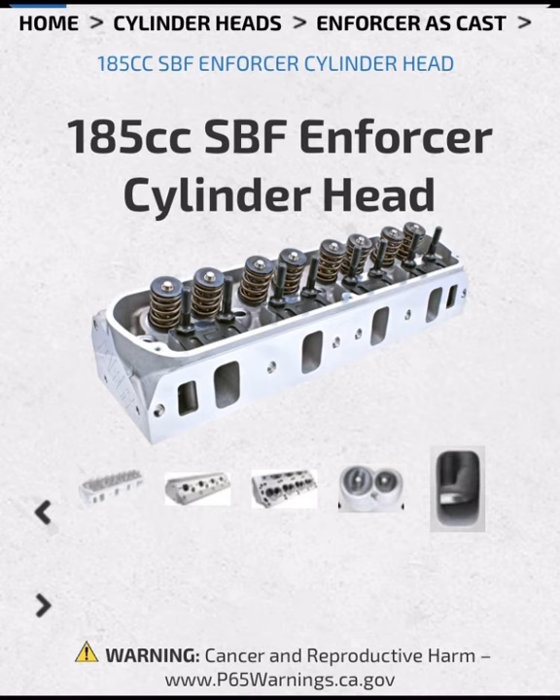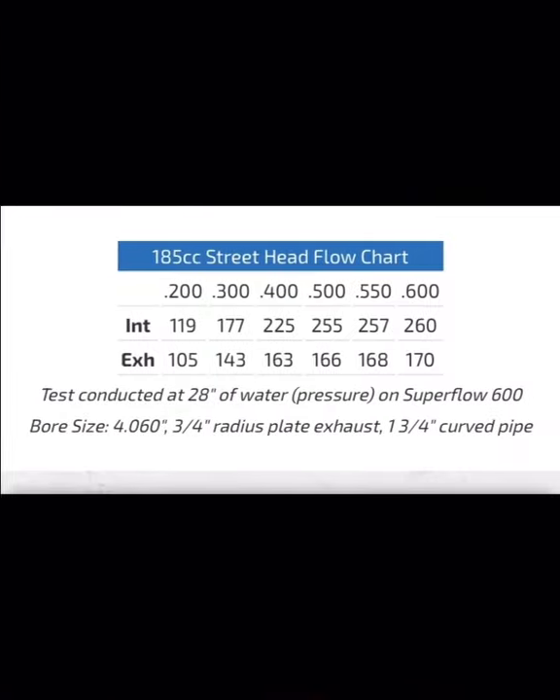That's not even the biggest issue. The biggest issue with this head is the thin deck — it's only about a half inch thick, and that's data they're providing. With only a half-inch thick deck, you're begging for issues, whether it's warpage or a blown head gasket. The cheap alloys in these heads are prone to make that kind of stuff happen. My porter and machinist both said these things have a cheap alloy, and especially if you're boosting, that thin deck is a recipe for a blown head gasket.